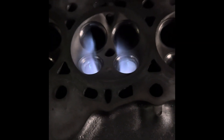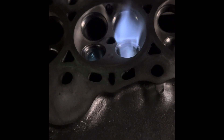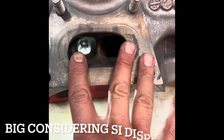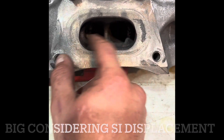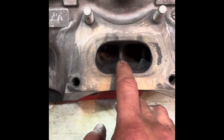There are three possible ported options and that's the best you can get right there. I'm going to show you - we'll put this in the port and try it. You can see some turning towards the middle. At the bottom of the smoke, place it at the center - there's the port here. We can see the flow. I don't see any need to touch this area; it's pretty big honestly. I really just don't see any need to touch any of the center area - polishing it out is just killing time for about four CFM.